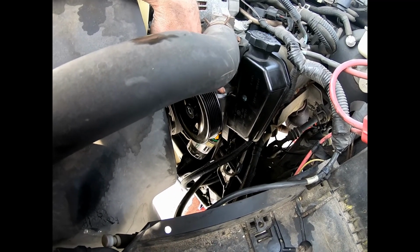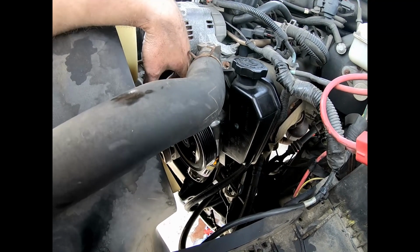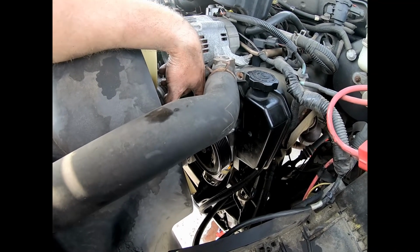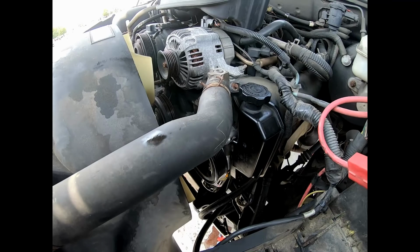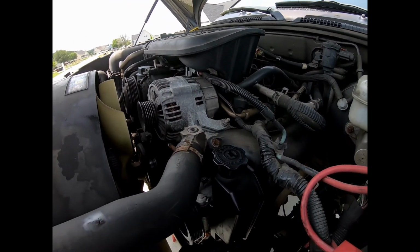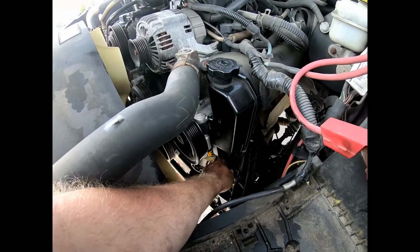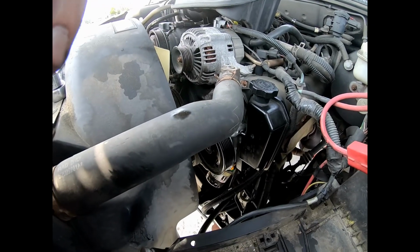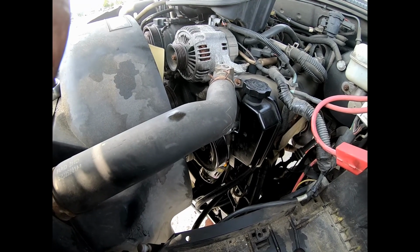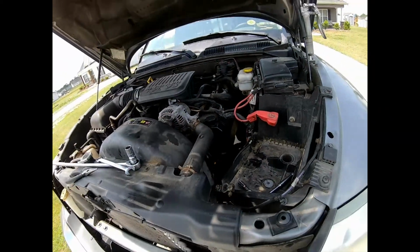The bolts, there's 3 bolts that hold this power steering pump reservoir on. All 3 of them are 10 millimeter. The 3 bolts that hold the power steering pump onto the engine are, let's see, they are 1/2 inch. Yes, they're 1/2 inch. What else? You got your reservoir tube here, just reattach that, and then I got to put my high pressure line into the pump and then reattach my serpentine belt and turn it on, see what it does.